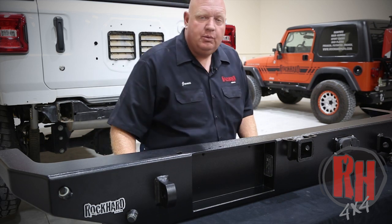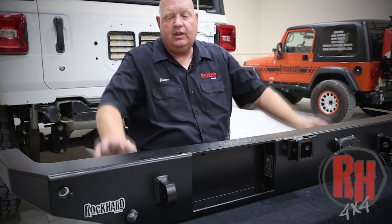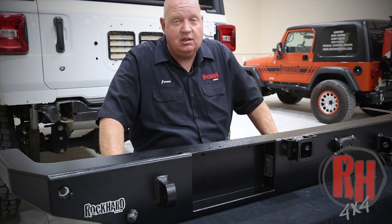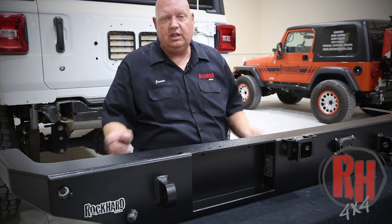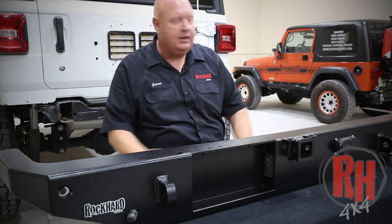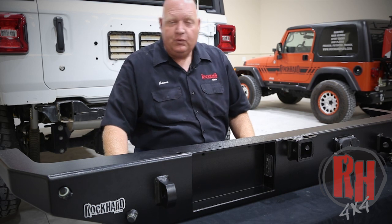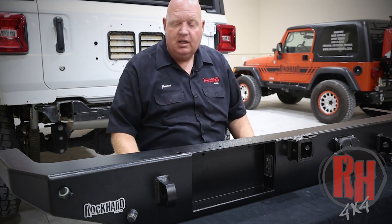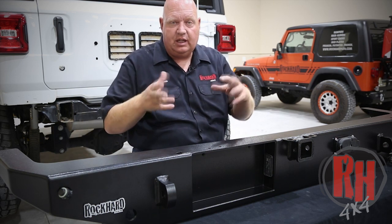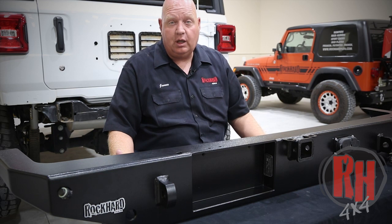Now when you're doing your electrical sensors, let's talk a little about the wiring harnesses and the differences we've found in the JLs. We found some wiring harnesses where everything matches up and we don't have to do any modifications, and we found a few that we do have to do modifications — probably more that require modifications than not. It's not a big deal to take all the tape off the back of the complete wiring harness. You'll find that you only have to extend one wire, and that's going to the third sensor. We include a piece of wire and some butt connectors so you're able to do that.